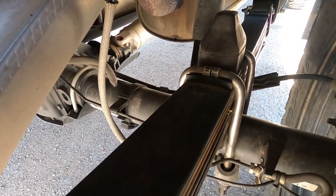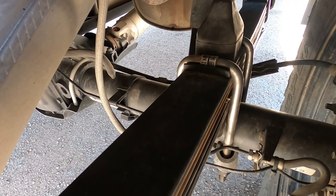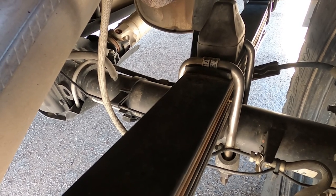In addition there are new U-bolts on there, so they had to take everything off. When you do that you want to make sure you replace the U-bolts — you don't reuse those U-bolts. The downside is I have to re-torque them after a while and I don't have a torque wrench. But I'm pretty happy — I'm glad I got it taken care of. It's not easy taking care of this stuff on the road in different towns, but everything kind of fell into place.